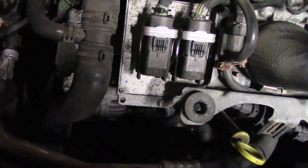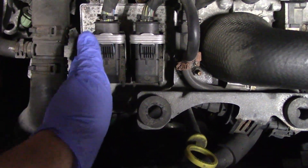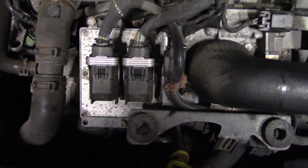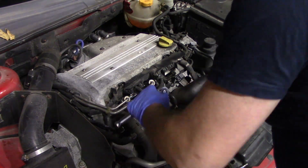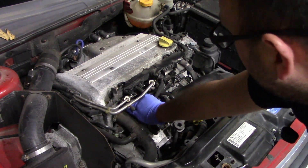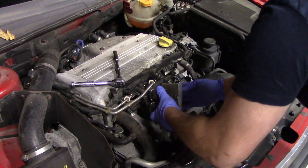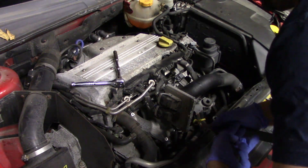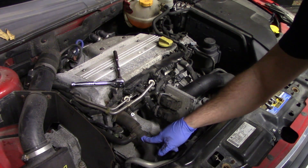I may actually move the ECU for this. I don't think I need to, but I'm going to move it out of the way - I want to be safe, rather be safe than sorry. Now I'm just taking this and moving it out of the way; I'm not actually going to remove it completely. At this point this should be really simple - grab an angle pliers and undo the three hose clamps. I'm going to start with the one on the Tee and then do the two big ones.